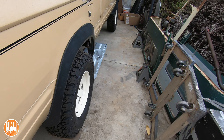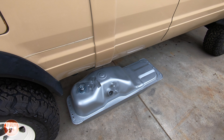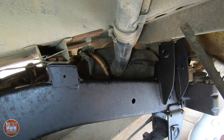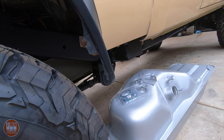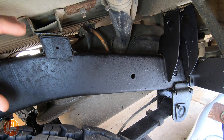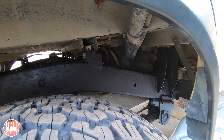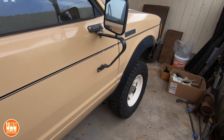I also bought a new fuel tank. The one that's in it is probably fine, but I'm sure it's dirty from the gas sitting there so long, and I don't want possible rust continuously clogging up the carburetor. Gas tanks are cheap, so I just bought a new one so I don't have to worry about it. I've also got to replace a lot of these smaller fuel and vent lines — they're so old. You might also notice I painted the frame. I spent about a day laying underneath this thing with a quart of POR-15 and a brush and just painted everything I could reach. When I pull that tank out I'll paint some more of the frame, but it made a big difference and is going to help keep the rust down.